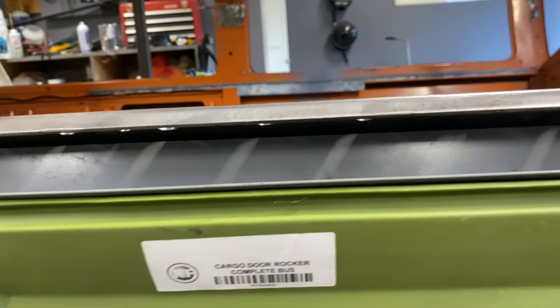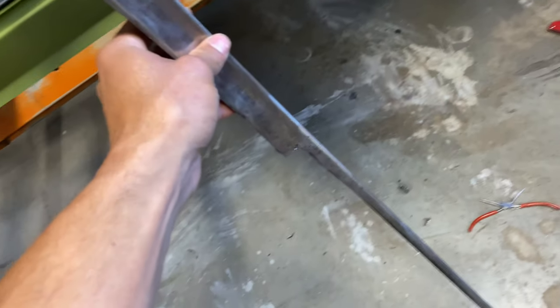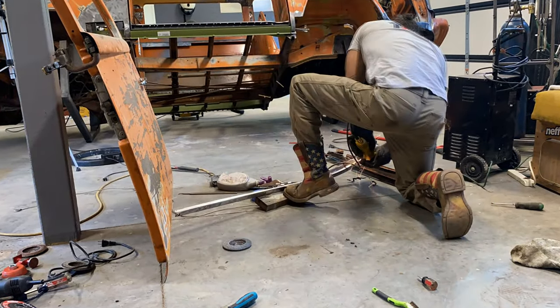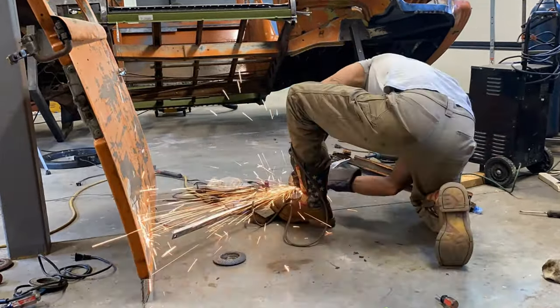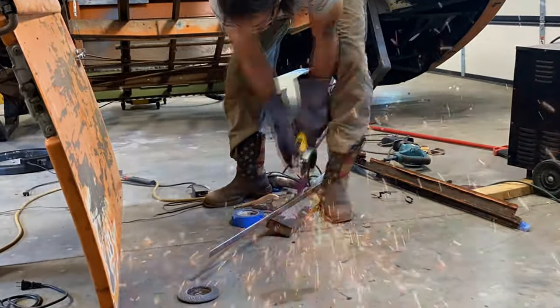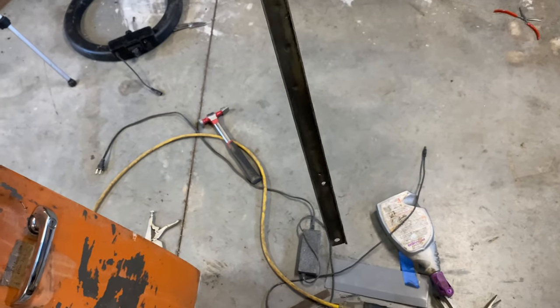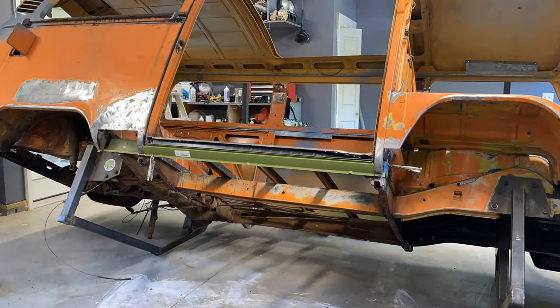As you can see, that middle rocker is looking pretty well lined up — I'm quite happy with the fit — and it's time to get to modifying this upper rail. In the last episode I said I was gonna keep that curve, but I decided I'm not going to. I'm gonna cut it all off and then bend the middle sill to kind of match that curve, so I'm utilizing as much of the brand new metal as possible. I think it's gonna work out just fine, as the top rail and the bottom rail kind of function independently if you look at how the wheels are set up.